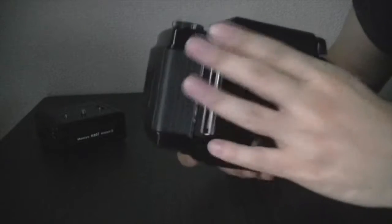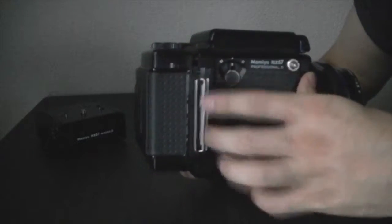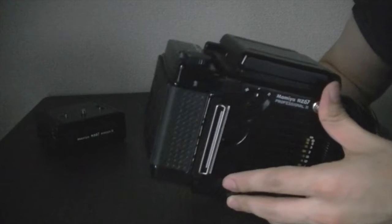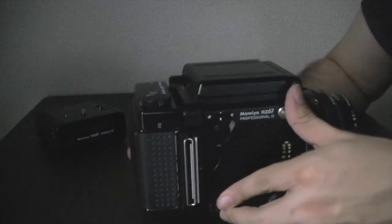This position here is what they call the normal position. In the normal position, the camera keeps the shutter count — when you crank the lever, it will move to the next frame. It makes sure that every time you shoot, there is film and a new frame available. It will not let you shoot if there is no film, or if the frame still hasn't moved, so you need to crank it up. Basically, it just prevents you from doing multiple exposures or accidental double exposures.